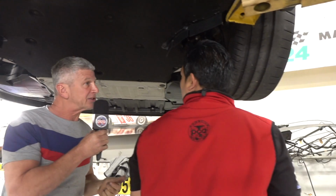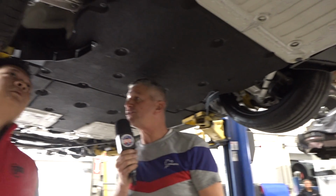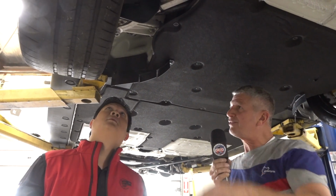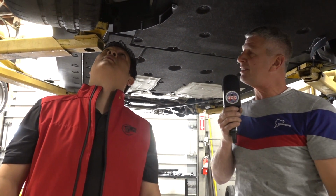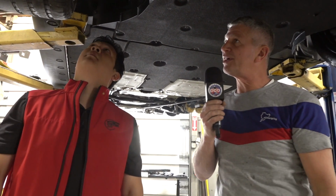That really controls when you get on the tire, when you first get into the grip area of the tire. That acts like a little bit of a nose on the spring. It softens the nose up. It's really to accommodate that more than anything else. Same on the back end of the car. It had the same type of spring. Because when we put them on the spring dyno, you can see the nose of the curve is slightly softer, even though they're almost completely compressed, versus a straight spring. Yeah, it has a different signature.